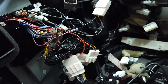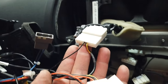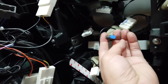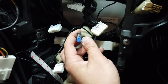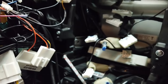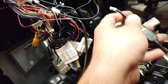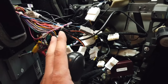The antennas you can leave behind the Tesla unit and go ahead and start connecting all your connectors. CCDV is usually the connector for the screen and this is your factory reverse camera — the signal comes from the screen and then the rest is all pretty much find your connectors and off you go. This blue colored connector is only for 370Z models after 2010 in some regions — 2009 models should not have a factory USB port. So go ahead and use the connector to retain the factory USB port and connect it straight into the Tesla unit. Pack that away.